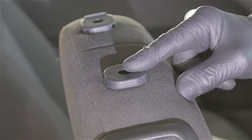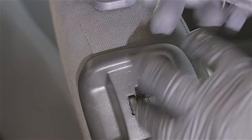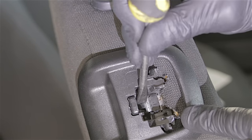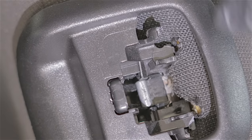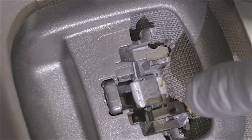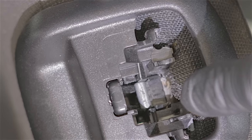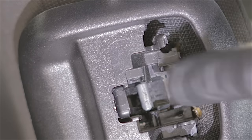Let's see if we can get this apart first. If you take the headrest out of the way, it just makes things easier. In order to get this thing off, which is in pretty damn tight, you don't want to try and prise it and yank it off otherwise you can do a lot of damage. You see where your cable is just there? If you get your screwdriver just a tad behind that cable, and shove it in there between the seat and the handle, you've got to try and prise the screwdriver down — and there's a clip there. If you can see that clip moving, if I prise the screwdriver down a little bit, I can actually release that clip. And when you push the clip in, you can kind of prise it up a little bit, and that's released that side.